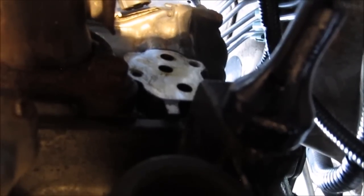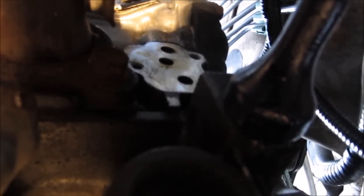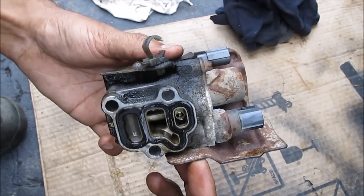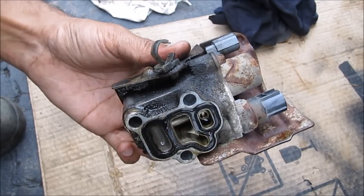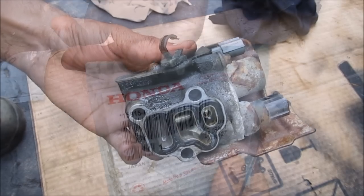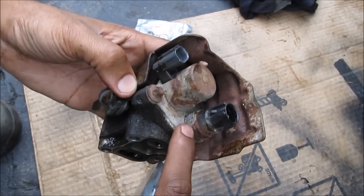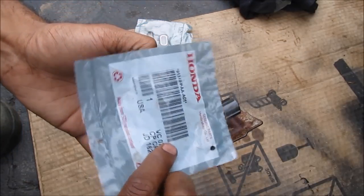There's a closer look at the mating surfaces — there are no studs to hold it on, so you're just going to have to catch your bolts. This here is your VTEC solenoid. It's responsible for activating the VTEC on your car. If you're getting an engine code for this, you might as well replace the whole unit. One of the common problems is this filter gets clogged and this gasket starts leaking on these 2.4L Honda engines. There's also an O-ring under the oil pressure sensor that leaks sometimes — it requires a 22mm socket to remove. This is what that O-ring looks like, and these are the part numbers for the new gasket, strainer, and O-ring from Honda.